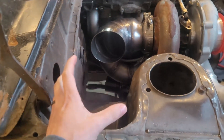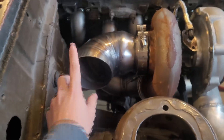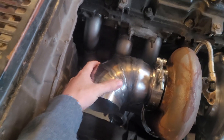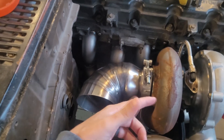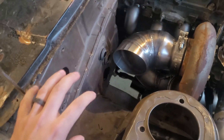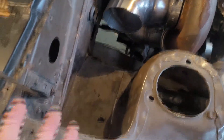We're going to bring it up and out here. For a decent amount of time we'll just have a nice stack, because I don't know how tall the hood is going to be. We also need to put a wideband sensor in here — probably right in this area. It's close to the header, so I might build a little heat shield. Thankfully the turbo manifold is long enough that we should get a good exhaust gas mixture, and because this flares out to four inches, the air speed should slow enough for the wideband to get a good signal. I'd rather have a sealed area for a good reading. Next we'll figure out where to go from here and start working on getting it up and out.